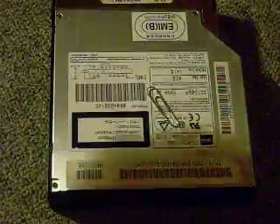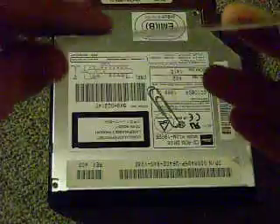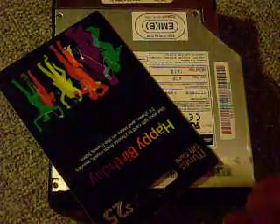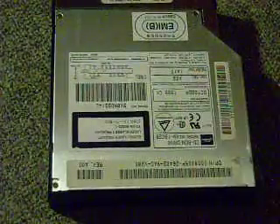You're only going to need two of them to kind of pull the CD out. To get the slot-loading CD drive out, you have to put one paper clip underneath the stuck CD and then put another one on top of the stuck CD. Then you just kind of pull on them and they'll come out, pulling the CD out with them.